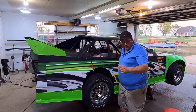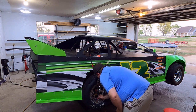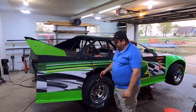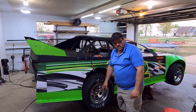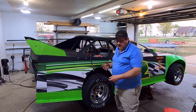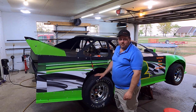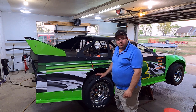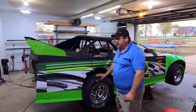I write the stagger measurements down on the wheels themselves. When I'm changing during the night, I put my durometer readings on the back side of the tire and my stagger numbers on the inside of the wheel. You can come up with a code if you don't want to share that information. I can't keep up with it on paper — I'll lose track — so I put it directly on the wheel. I go around and do this on all four.